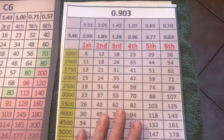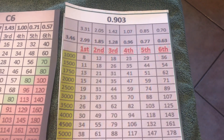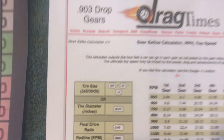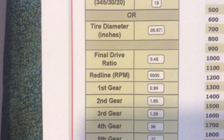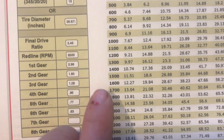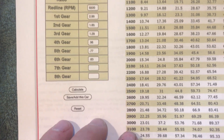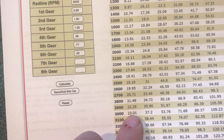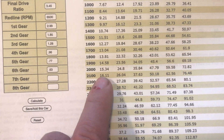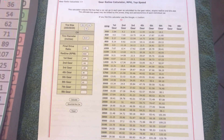This is just an estimate, but guys on the forum put these things together and it was really helpful to identify that there is a potential issue and that there are solutions. I logged on to dragtimes.com and put in my specific tire size — 26.6 inch diameter — and all the different gear ratios, to see what the more accurate numbers look like. At 3,000 RPM: 23 miles an hour, same as the C6. And cruising at about 75 miles an hour: 2,100 RPM. To me, this is a great compromise, and that's the reason why I purchased the drop gears.